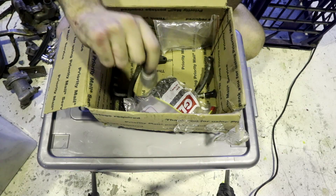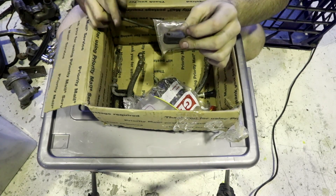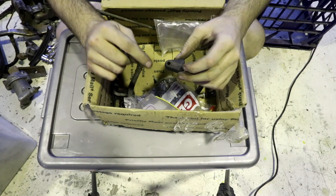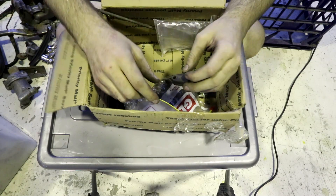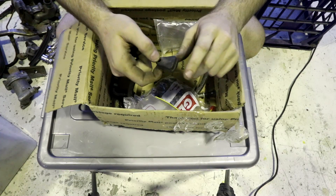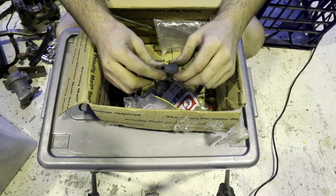We have a little rubber thing. I know what that is. The rear view mirror when we saw it before — it's got a clamp. On the S600, instead of the rear view mirror sticking to the windscreen or to the roof, there's a piece of wire rod up the middle of the windscreen, and you can slide the mirror up and down it. This goes on that rod and then touches the windscreen or something to stop it vibrating. I'm pretty sure that's what that is — it's a little rubber triangle. I'm going to call it rear view mount dampener.